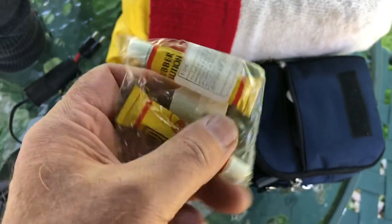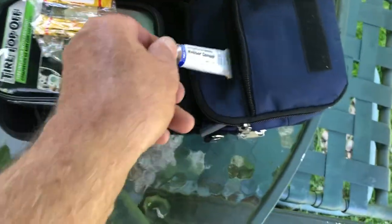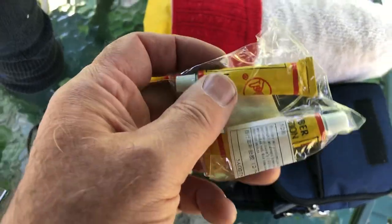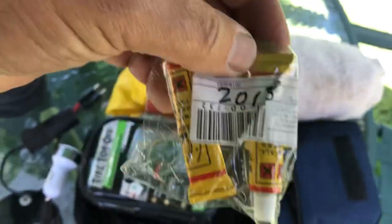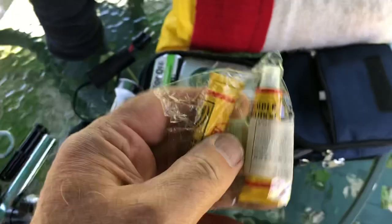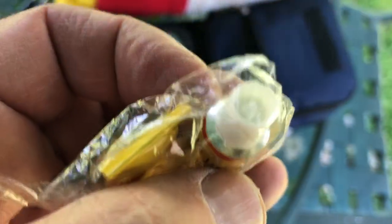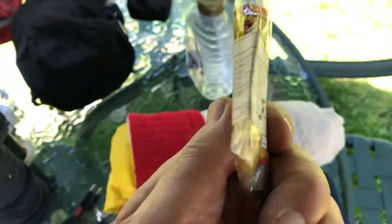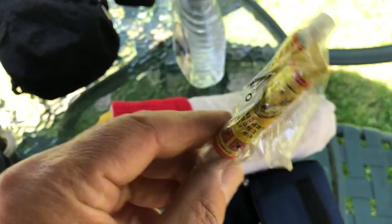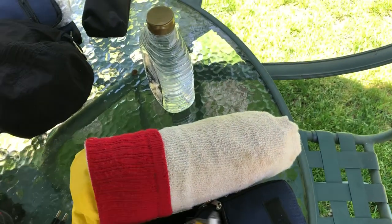Inside the kit I have packets of glue I buy on eBay — rubber cement, also called tire bicycle patch glue or vulcanizing glue. They're about 50 cents apiece. I date them — these ones are from 2018. The reason I buy small packets instead of big ones is there's a metal membrane under the cap. Once you puncture it, no matter how tight you make the cap, it's going to evaporate. So they're a one-time thing. I buy them a dozen at a time on eBay.